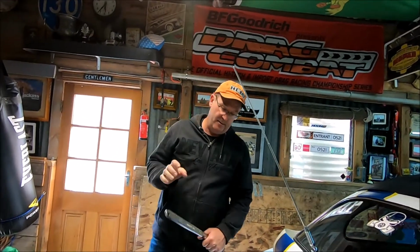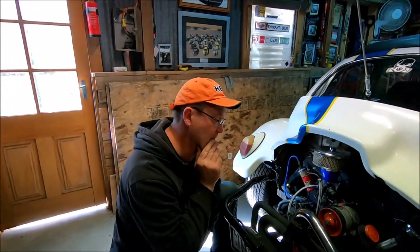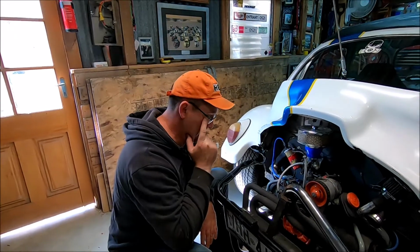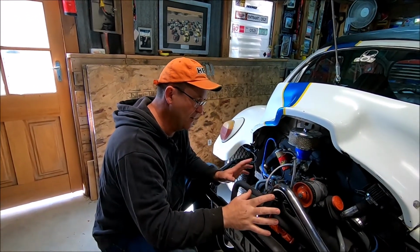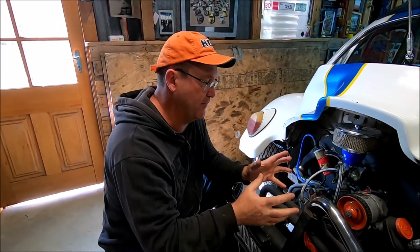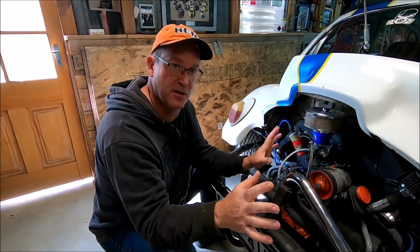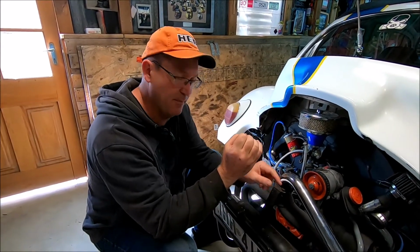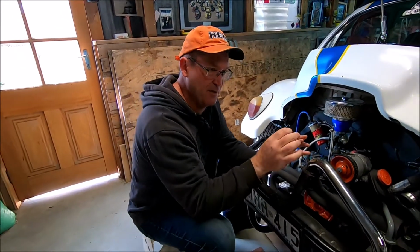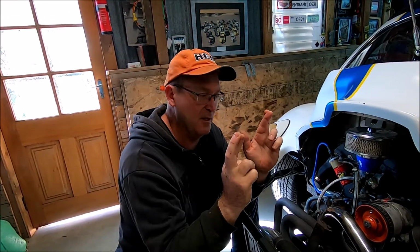But I've got a theory. I run a few Volkswagen guys and I talked to a few drag race guys, a few normal car guys just in the network, about what can cause this to lock up. I have this feeling that maybe the starter motor has totally crapped itself out. It's got a little bush that sits in the bell housing that's kicked out sideways, and the gears grabbed onto the flywheel and it's not letting it move. I'm crossing my fingers that that's what it is.